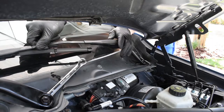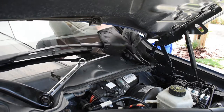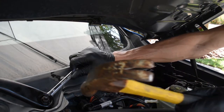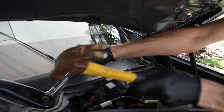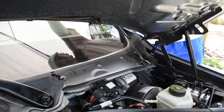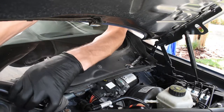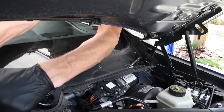On the left side that's where you put the wrench. The driver's side windshield wiper already knocked loose. It helps if you push the spring down to make it kind of level, which makes it easier to take off. With the hammer and wrench technique you're pretty much just setting vibrations to make it loose, while at the same time using the wrench to apply some upward pressure. Then we can take the bolt off and manhandle the windshield wiper off.